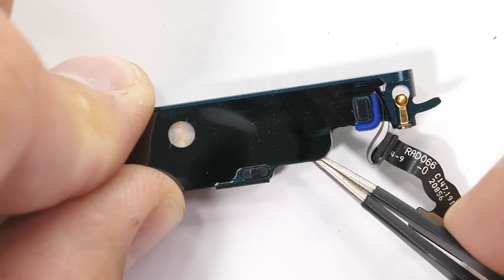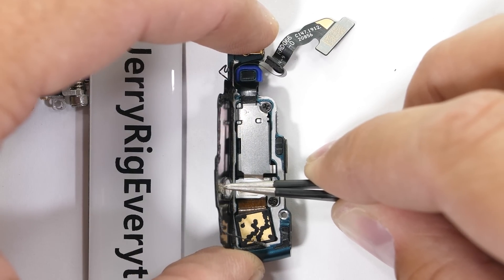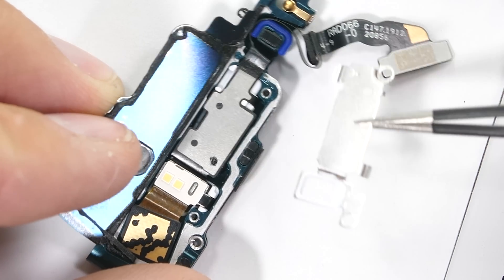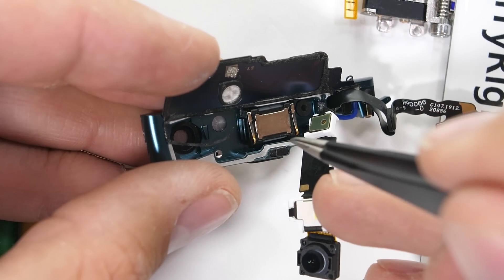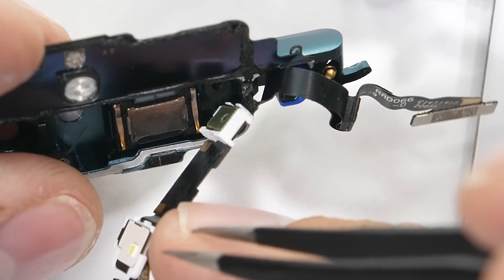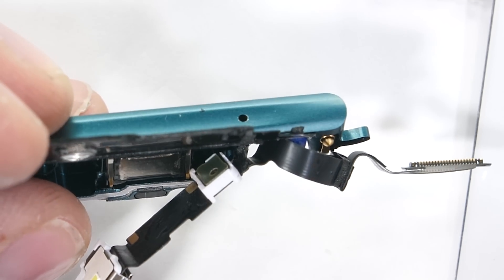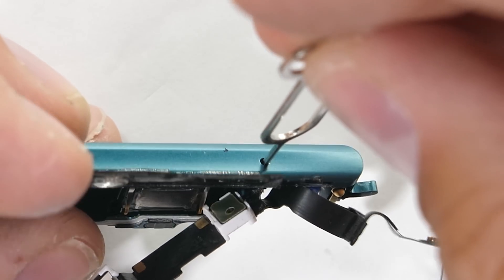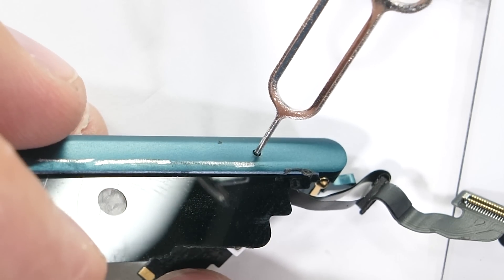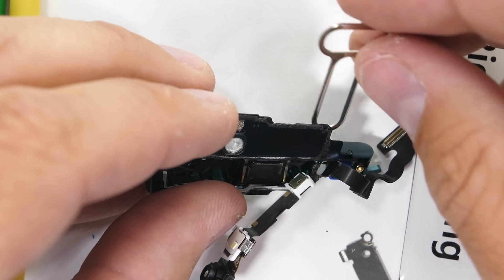Let's see what's inside this camera unit. The rear plastic layer is held on by a thin strip of adhesive. I'll fold that up, revealing the dual LED flash and two screws. I'll remove those and pull out the 16 megapixel selfie camera from inside the housing. And look at that — the earpiece of the phone is inside the camera unit. Did not see that one coming. The hole up at the top is indeed a microphone hole. The microphones are positioned off to the side of the microphone holes where SIM removal tools can't harm them.